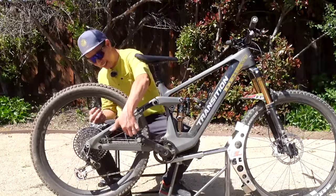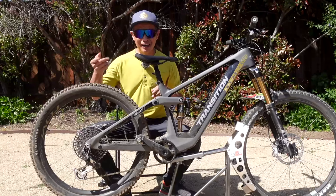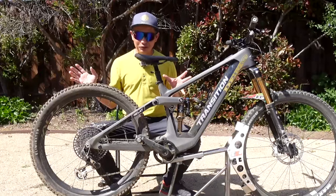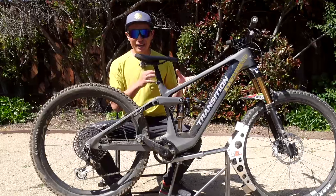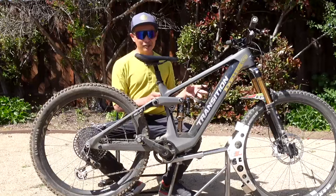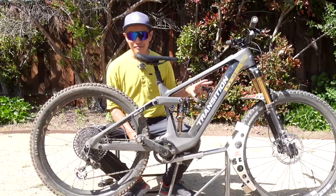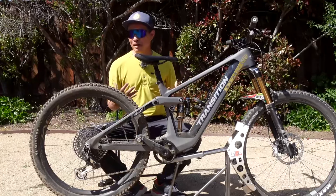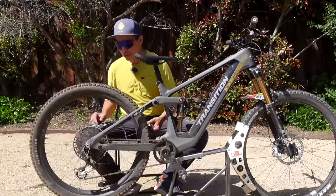But this thing is not really made for e-bikes — it still has 12 speeds, you still have that thin cassette and thin chain. They did add more material on top of the chain, but on my XX1 and XO bikes, those chains break quite quickly, often before 1,000 miles on turbo mode, and I replace them with GX or NX. Should you go out and get one for your e-bike because your Levo drivetrain wore out? I say no — too much money and you're not getting a lot of benefit. It's bling for sure.